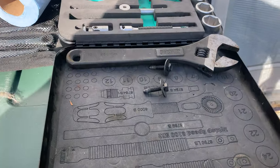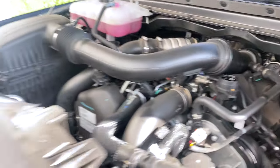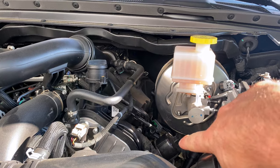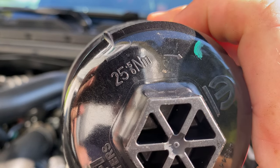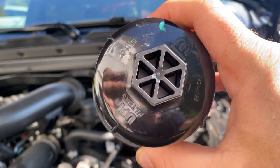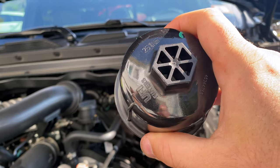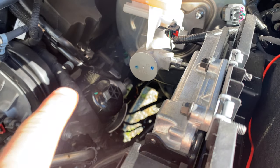If you're detail-oriented like me, remove the engine cover — it has two 10mm bolts, one by the oil filler and one on the other side. The oil filter right there takes a 27mm socket, which you can get at a hardware store. It's 25 Newton-meters of torque; these are plastic threads with a brand new rubber O-ring, so no need to over-torque. Just tighten it down, feel the resistance, give it an eighth of a turn, or use a torque wrench to 25 Newton-meters.